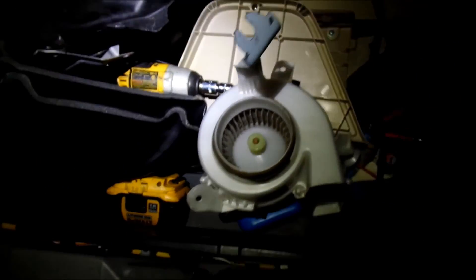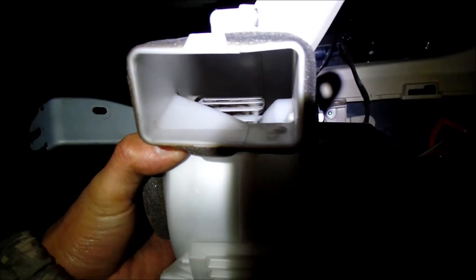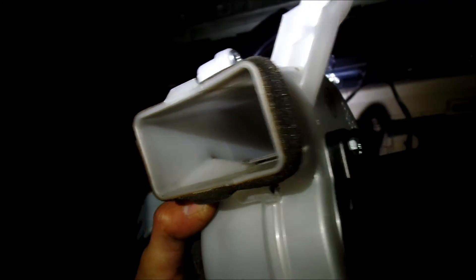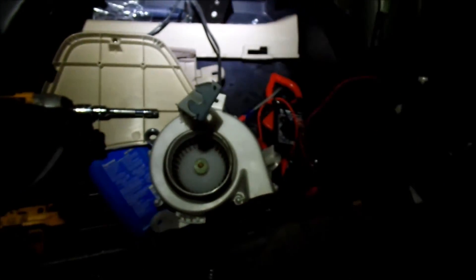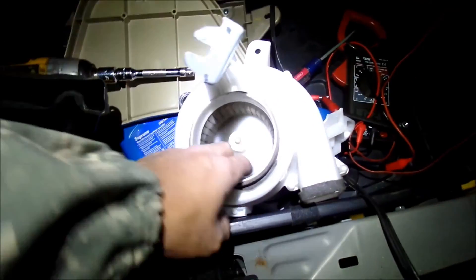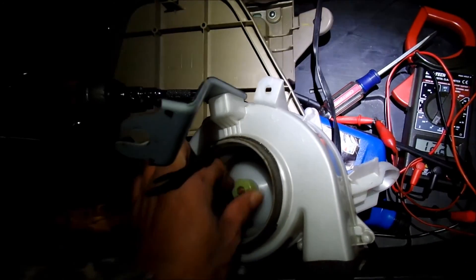There it is — it's out. I've already cleaned it, but there was a lot of dust and lint accumulated over time inside the blower, and it was only on one side of the blade which is kind of weird. You can see the blades from the turbine in there — it's still a little dirty. What I did was get a brush to loosen up all the dirt, then used a blow gun from an air compressor. You can also get a can of compressed air and just blow out all the debris. It doesn't spin super freely but I'm sure it's fine — it seemed to be working.